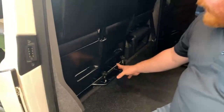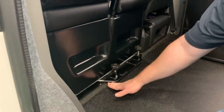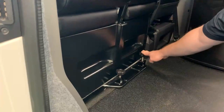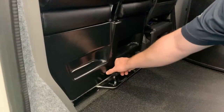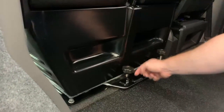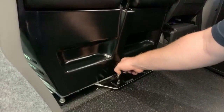Now the seat is fixed to the base via these bolts here, but what we actually have is the seat base, then there's a large white Teflon plate that extends right the way across the whole seat base itself, and then there is the base section that is bolted to the van itself. These screw bolts have a square metal bracket, the bolt goes through, and then we have a nut captured on the inside. As we undo these, there is a little lug sticking out from the side of the bolt.